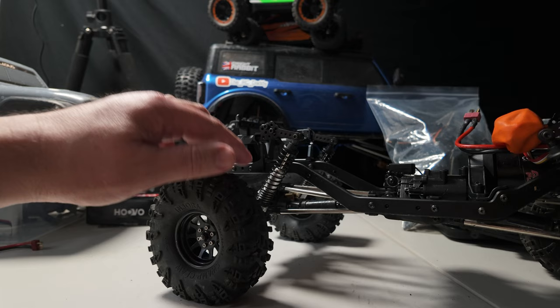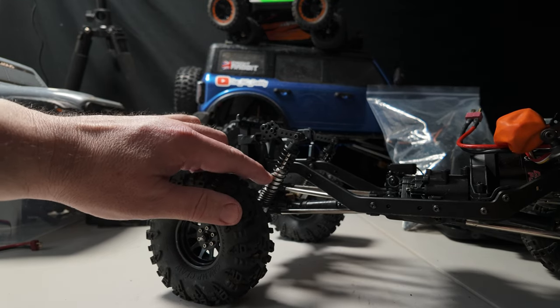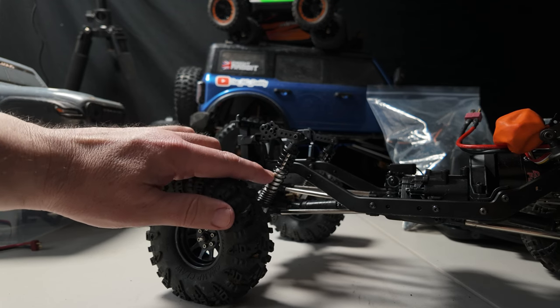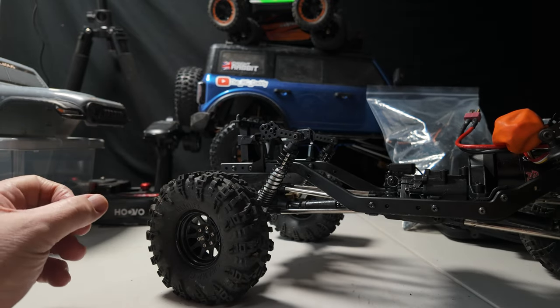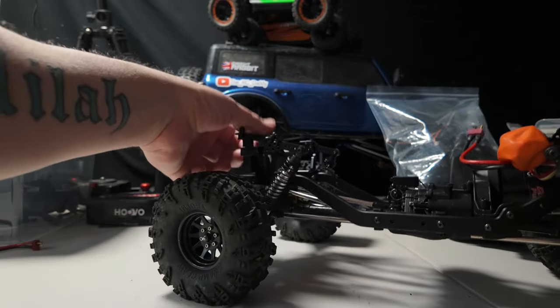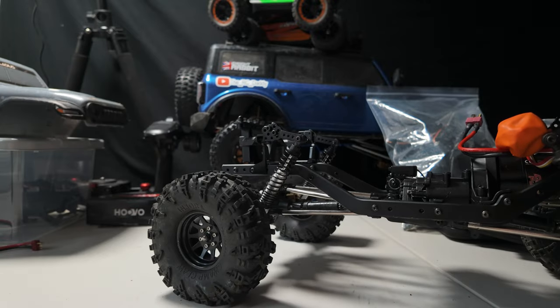And he was correct. I can't remember if I went small spacer seal, large spacer seal, or some variation of that. But I did that, and these sealed up absolutely perfectly. I'm running 40 weight in these. And they work. They're still a little bit oversprung, but it does a nice job.